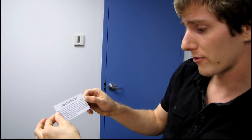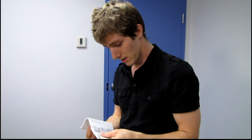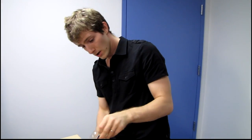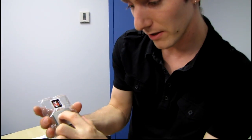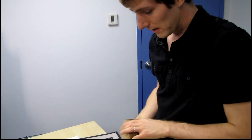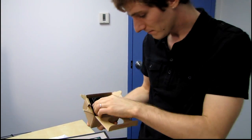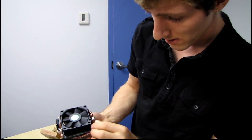Important note: prior to installing your AMD FX CPU, go to your motherboard manufacturer's website and download the latest BIOS — this is very important. Inside the box we have an instruction manual, a certificate of authenticity, a three-year warranty, installation instructions, the AMD AM3+ FX-8150 CPU, an unlocked FX sticker for your case, and an AMD-approved heatsink and fan combo made by AVC.